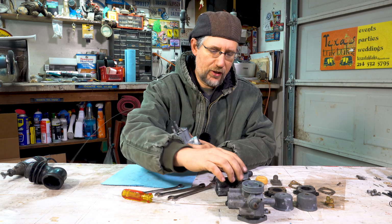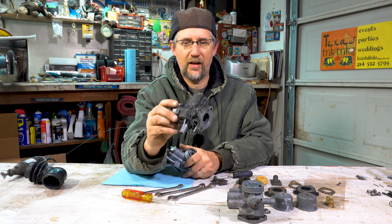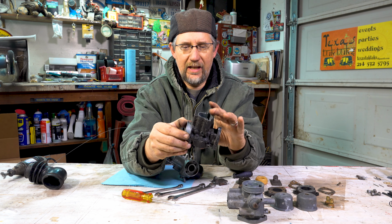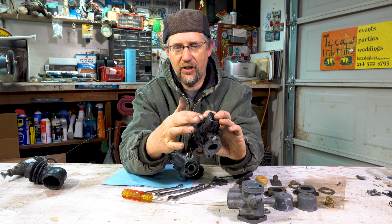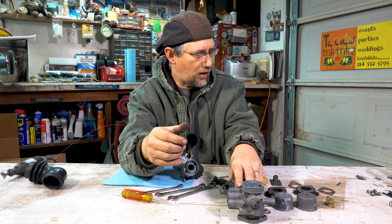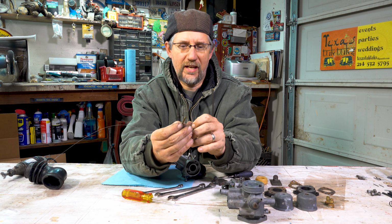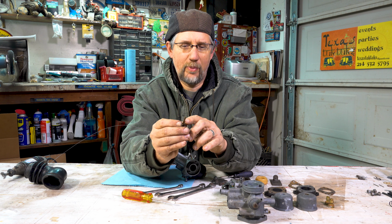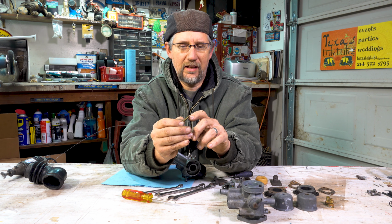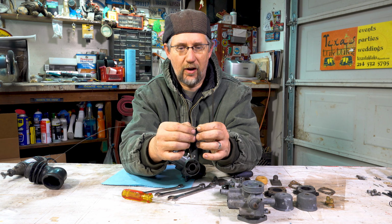And I wanted to show you this carburetor real quick. Here's one of the reasons why you'd want to take a carburetor off. Over the years, just a little bit of gas and oil will get on the outside, and it's a magnet for just gunk and road dirt, and you get all this grime. And then on the inside, you have all these little bitty small jets. And fuel has to run through these jets. So all these little bitty tiny pinholes, if any of those get clogged with anything, it's going to make the car not run right, or run badly, or not run at all.